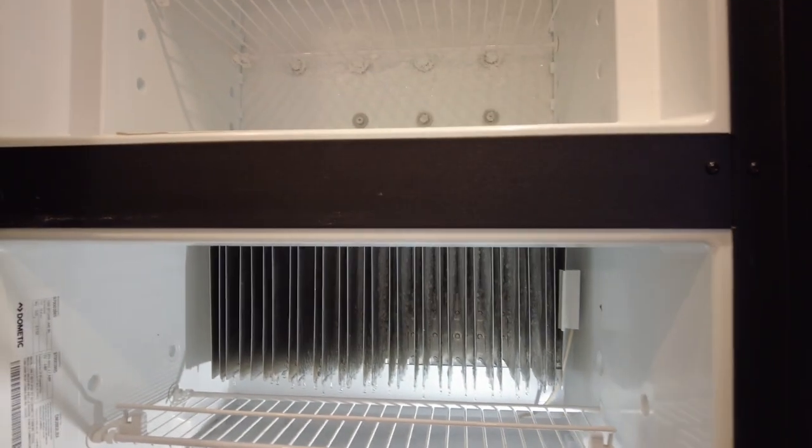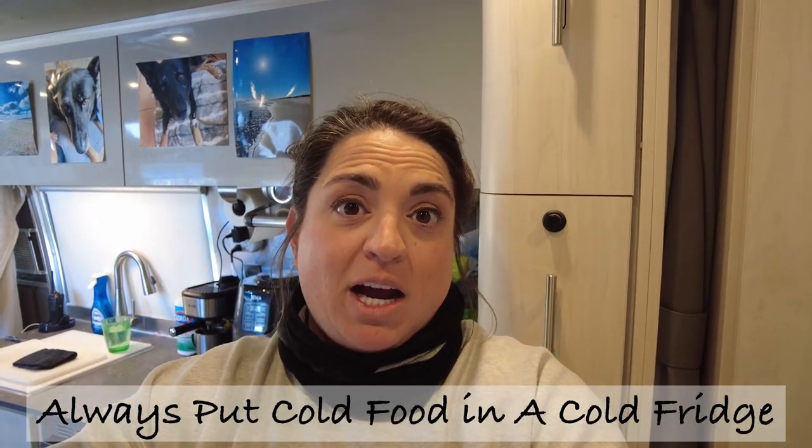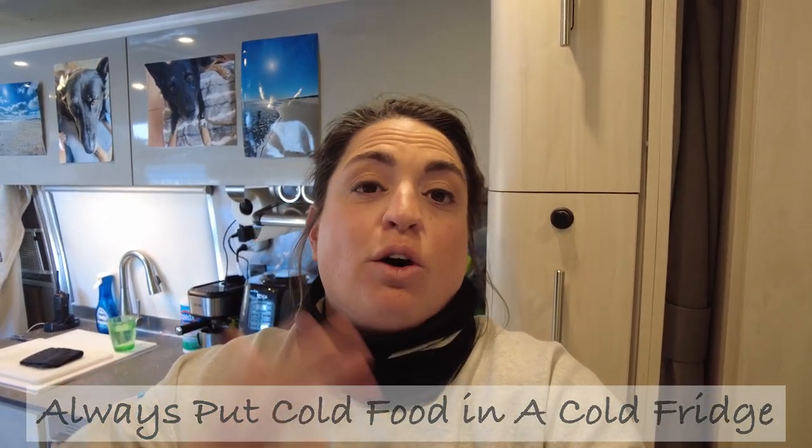As you can see, all this is nice and frozen — it's actually pretty thick up top and down here it's not so bad. Honestly this is not that bad; I've had it so much worse before. But it's important that all of that comes out. If you leave it to just thaw on its own it would take forever, and then you'd have to close everything up, power the fridge back on, and wait another two hours or so at least for the temperature to drop down cold enough that you can safely put the food back in.